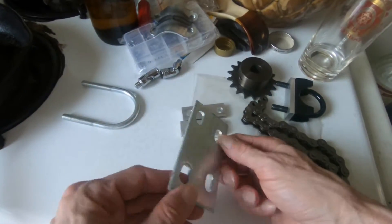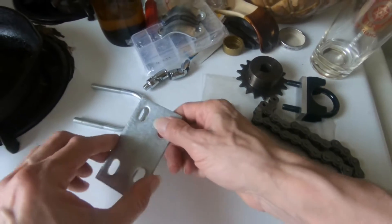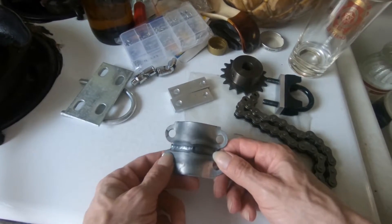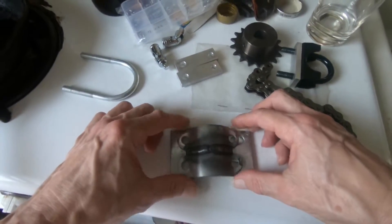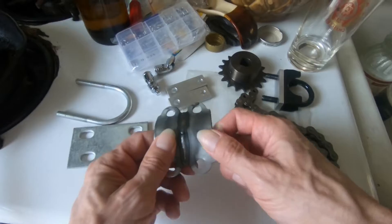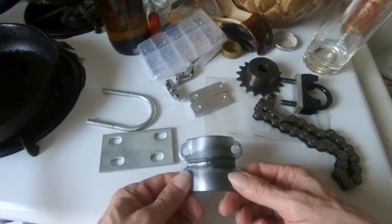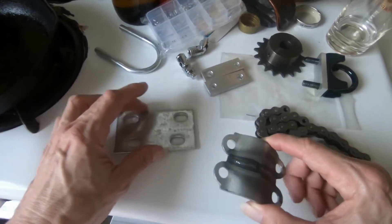There's just not enough room to get this in there. First of all, it's too thick, and it's just not going to fit. I needed this to be rounded. So what I did was this — it's just two motor mount brackets from Bikeberry that I had welded together. Essentially it's the same idea as that plate but with a curve in it. I need that because my motor is just right up against the down tube. I haven't test-fitted the welded version yet, but I have test-fitted them separately and I have to kind of slide it down in between the engine and the down tube — there's that little room. I think this is going to work and hopefully I can move on to the rest of the problems.